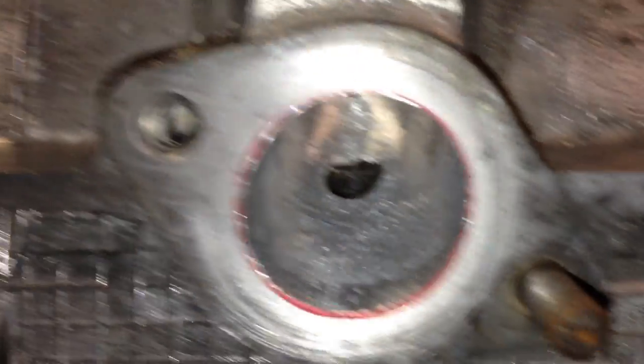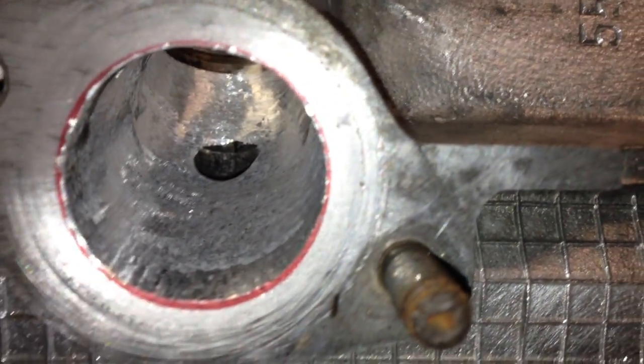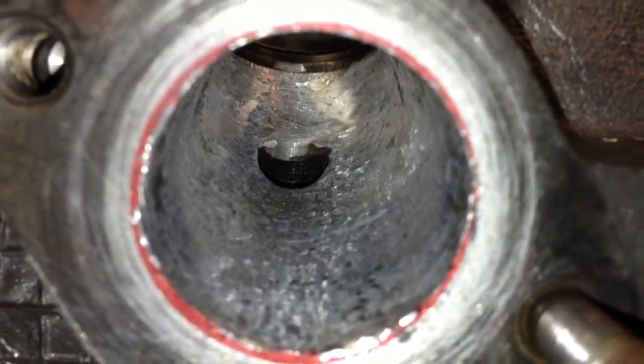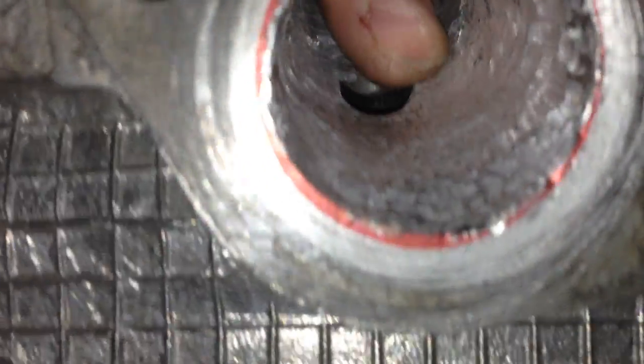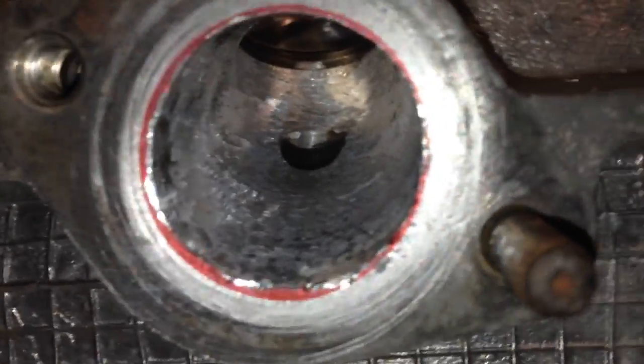The exhaust at this point I've rough cut only — that's just with various shapes and sizes of burrs and stuff like that. Have a look inside here for the exhaust. Up to this point I would say we're at a rough cut stage, where you can start with sanding type abrasives. It probably took in the order of about five to six hours.